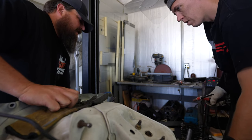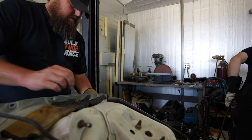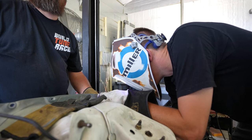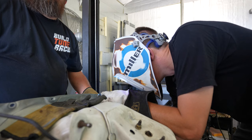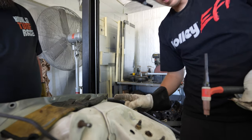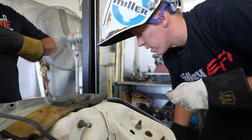I can't weld with my grinding shield — I want to be able to see afterwards. I don't think we cleaned that side very well. Yeah, I forgot to take the paint off — step number one before you weld: clean the paint. So I've got to wire wheel the crap out of that first before the next weld.